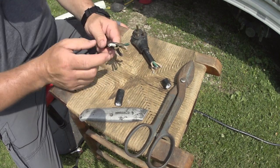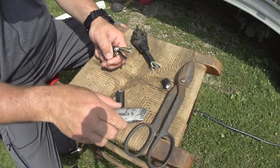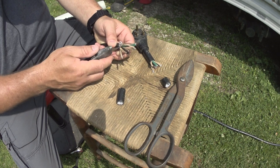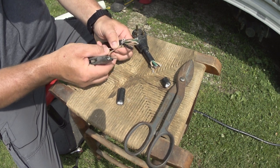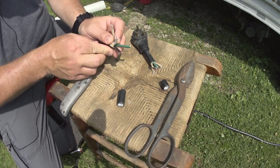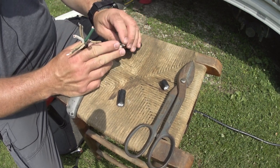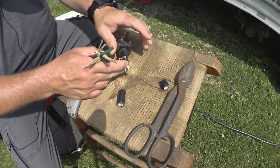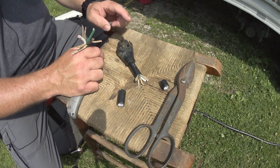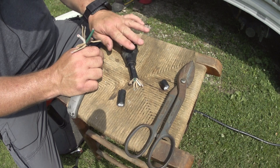All this is three wires. So don't be intimidated by all this stuff. This is just insulation, that's all it is. This is some sort of a fiberglass strand wrapped with some paper. What I'll do is I'll trim away all these little paper pieces to where I'm left with these three wires. I'm going to take my meter and I'm going to trace these three wires back to their appropriate plugs to make sure that it's connected the way that I'm going to connect up the new one, because I believe the new one is color coded correctly, but I just want to be sure.